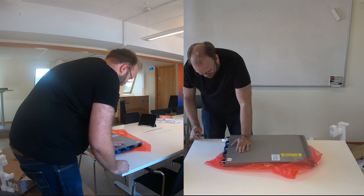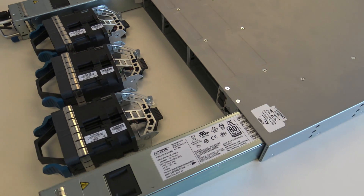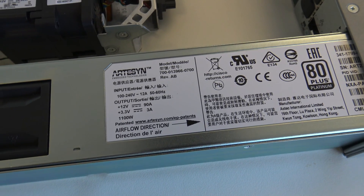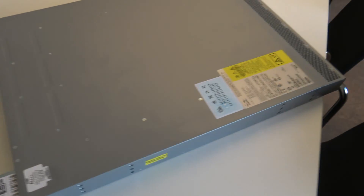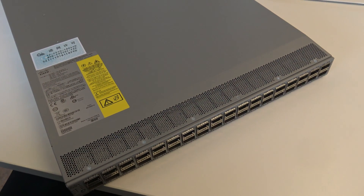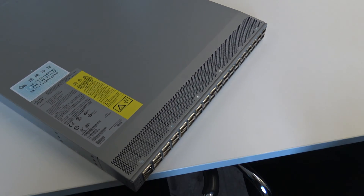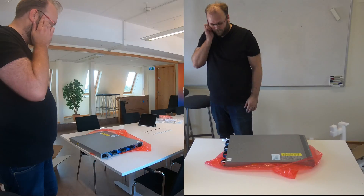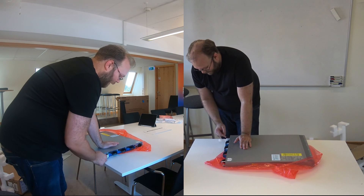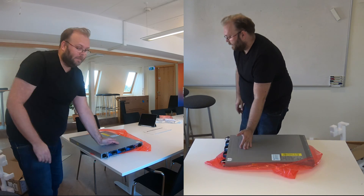All three of them are possible to take out. One thing to really keep in mind is the airflow of these ones. If you check here on the power supply, it actually says airflow direction, and the air flows out here next to the ports. So the ports are meant to be on the back side of the rack at the same place where you have the server ports, so you have easier cabling. There's also a little flap here — I normally put the asset ID and name and so on on the switches so they're easy to find.